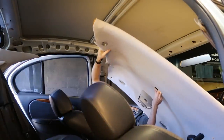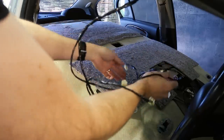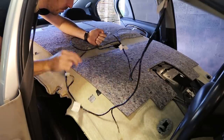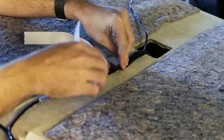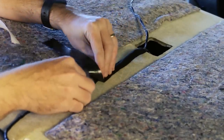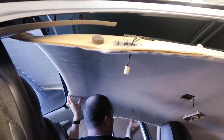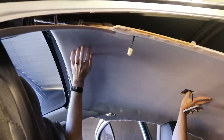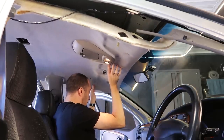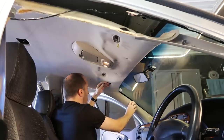A week has passed and it's now a beautiful Saturday morning — a perfect day to install a headliner. With the headliner sitting in position it's time to get all of the roof wiring in the correct places. Take your time here to make sure you get the layout right because there's no going back once the headliner is installed. Ford actually used tape from the factory to hold the wires in place, which is a really good idea since the wires might move between now and actually raising the headliner into position. I've raised the front seats and I'm starting by clipping the headliner in behind the C-pillar plastics to hold up the rear section, then moving on to clip the front half in behind the A-pillar plastic covers.